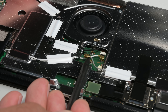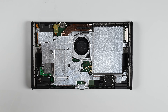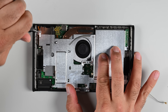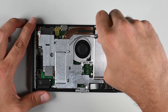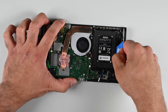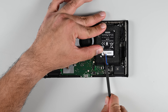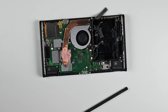Inside, three antennas and coax cables run across the middle of the device. Two antennas are on spring contacts and one is physically attached to a coax. I remove a securing bracket, disconnect the microSD Express reader, then remove five screws holding the shield and pry that away too. There's a good bit of clay-colored thermal gunk under here, and now I have access to the battery. Battery removal turns out to be an absolute mission — lots of prying and alcohol, and the thing won't budge. The isopropyl and a full set of pry tools finally gets me through, but the foam glued to the battery has basically disintegrated. Just as bad as the original Switch and just as bad as the Steam Deck.